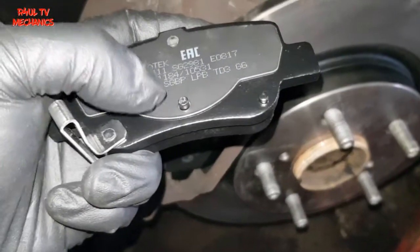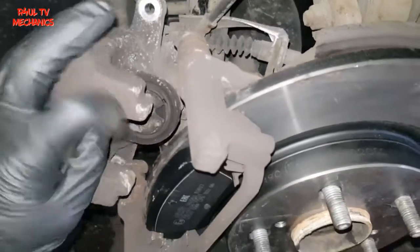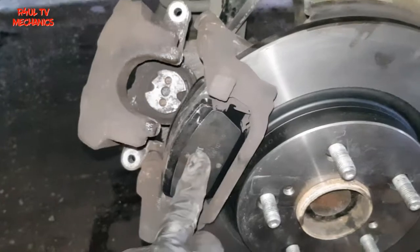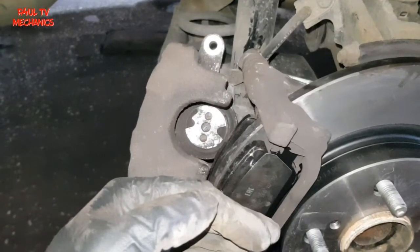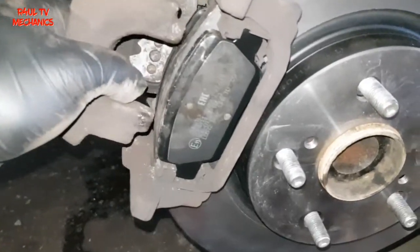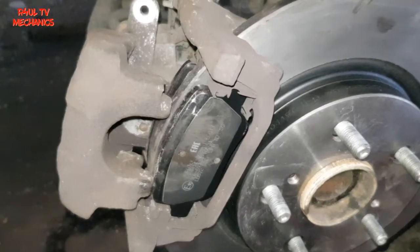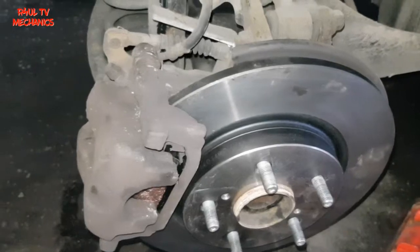This protrusion here on the inner pad — make sure it lines up with one of the cutouts on the caliper, either this one or this one. When we bring the caliper out a little to adjust it, make sure it's lining up with that protrusion. As you can see, the brake pads are on, the disc and rotor are on, and the caliper is sitting absolutely horizontal. That's going to line up with the cutout on the back of the pad. Put it on like that, go straight on, I need two hands. The caliper is on — happy days. I've put a bit of copper grease on there. Put the wheel back on, pump the brakes up, handbrake on — should be okay.